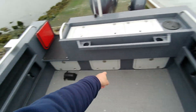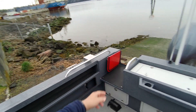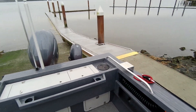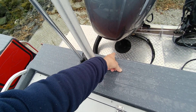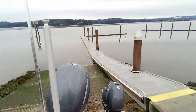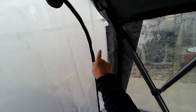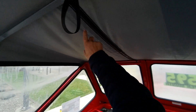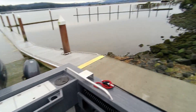Got a drain slit back in there so water that gets on here goes in there where your pump pumps it out. Rear entry door — that's to get to your pump. You can also get through there to get to your lower bolt holes, and it's a little easier to get to your bilge pumps if you ever have to change them. The top folds back and snaps right here, and these snap here instead of on the outside. They use seam sealer on the tops and Velcro so they don't leak — they're all going to leak a little bit, but it helps.